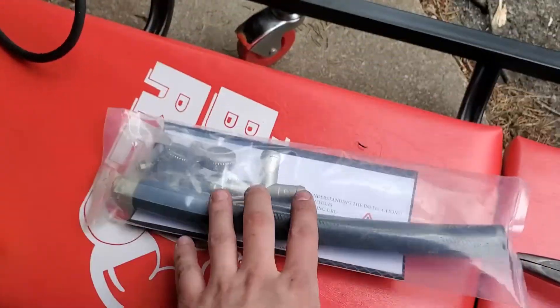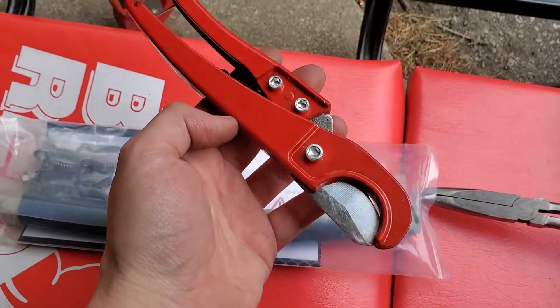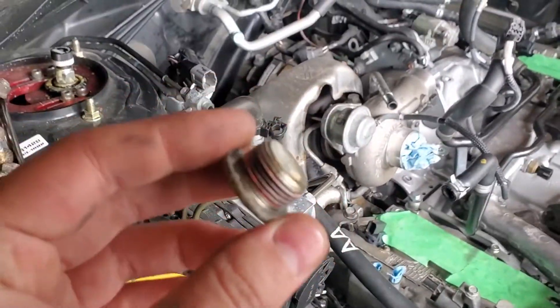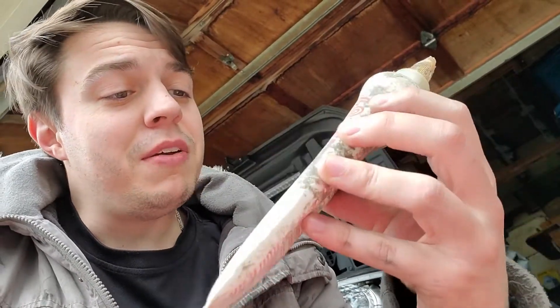From my understanding it's not too difficult to install — pretty straightforward. There's just a hose, a stainless steel T, and some hose clamps. You're probably just going to need a decent set of hose cutters and maybe some pliers. I already went ahead and removed this plug on the back of the block. That hole right there is the spot we're going to be threading the hose into. You'll need some type of sealant — I have Loctite 567 thread sealant, which is meant for hydraulic hoses, so it'll do the trick. We're only going to use a dab.